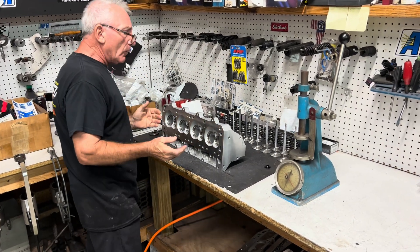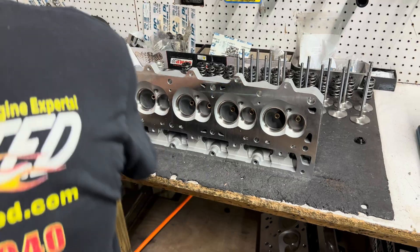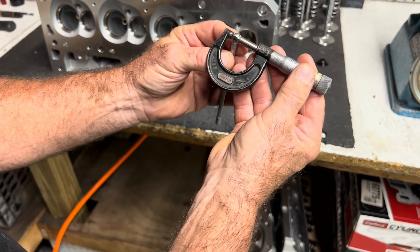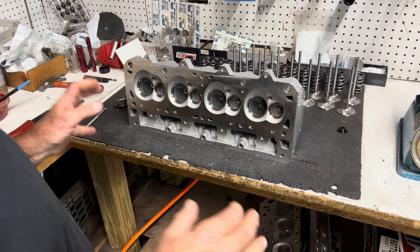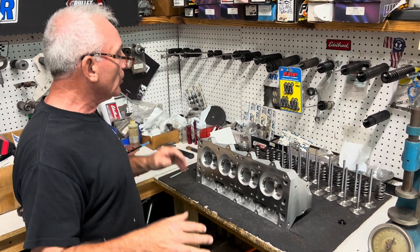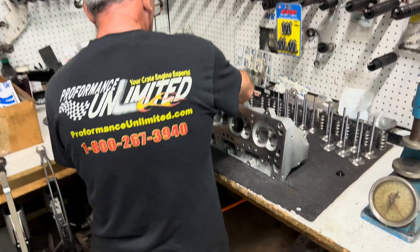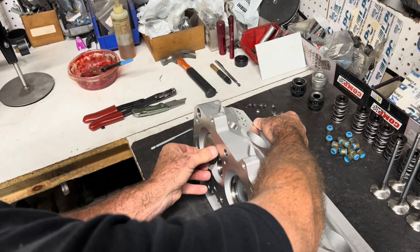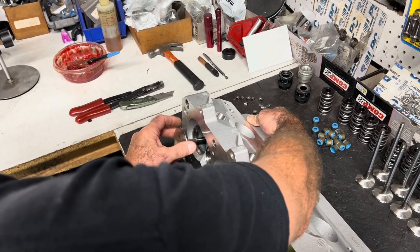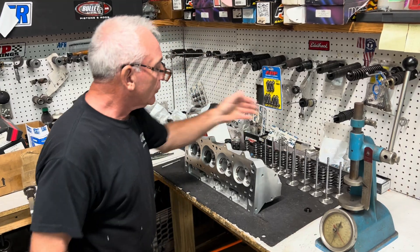You can take a ball mic, put it in the valve guide, open it up, and use a one-inch micrometer to measure the guide bore — it's sitting around 0.312 here. Then mic the valve stem. If the clearance isn't right, you can use reamers or hone the bronze guides to get the clearance you want. As you can see, this valve sits in its guide beautifully. An old trick: put your finger over the port and if you hear a pop, you know the valve and guide don't have excessive wear.